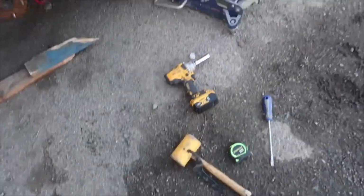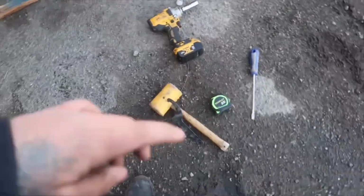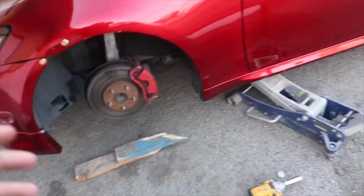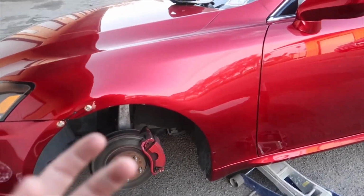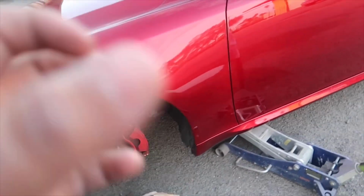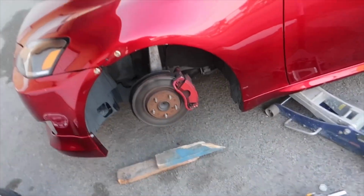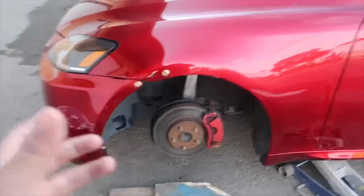So it's really simple to lower the coils. If you guys are new to coils and everything, it's not really hard. I highly recommend that if you're gonna drop the car when you first get the suspension, do it before you put it on the car, because that's when the strut is in the spring, it'll move freely. When you have it on, you get oil on it, you get dirt on it from driving it, and it just makes it stupid hard to move it around.